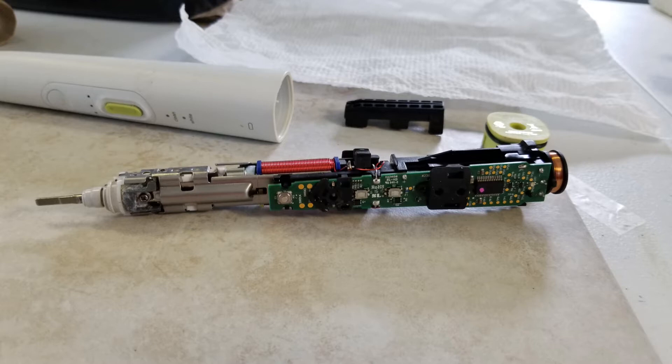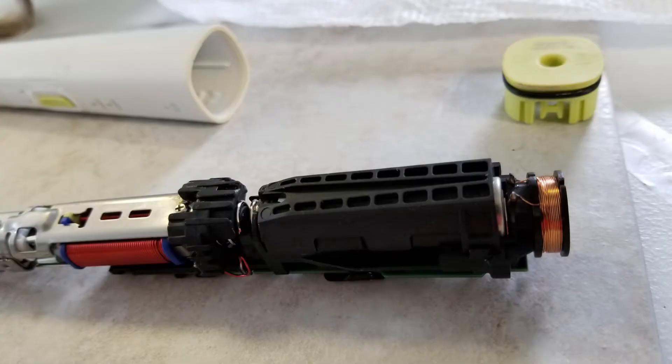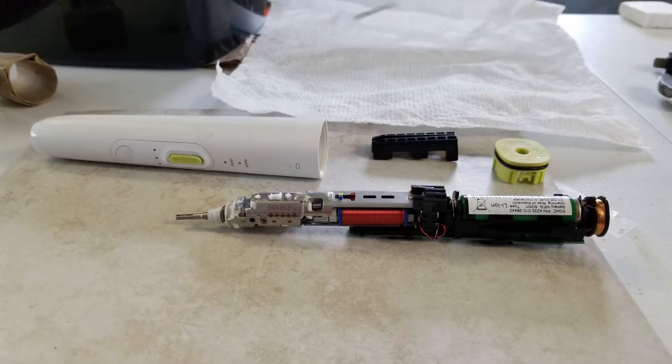When I did that, I found there was a lot of condensation and water inside the toothbrush. I dried it off with a paper towel and then sprayed it with DeoxIT, which is used for electrical contacts that have gotten corroded or wet and restores them to working condition. I really soaked it with that stuff and left it overnight to thoroughly dry out.